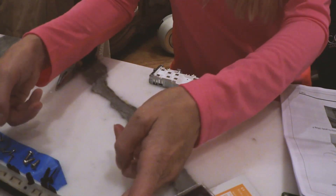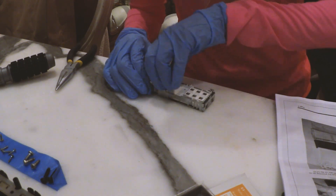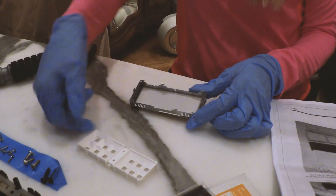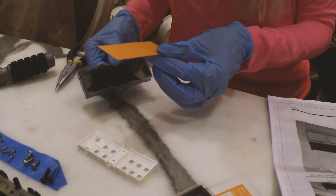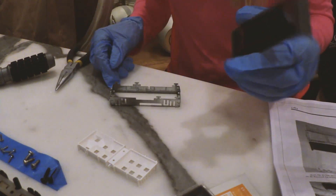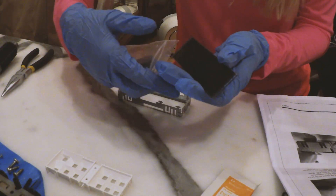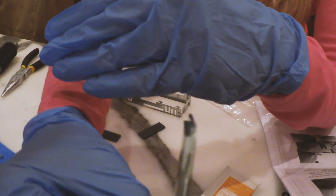Don't turn it because there are little buttons and things that can fall and get lost easily. There's a card inside here — let me get my fingers around there. So there it comes out, and there we can see the card. The gray flexible bits actually conduct electricity. There's the bad one — bye-bye. Touch the front as little as possible. And the little zebra connectors are in there. Let's take a look at either side.